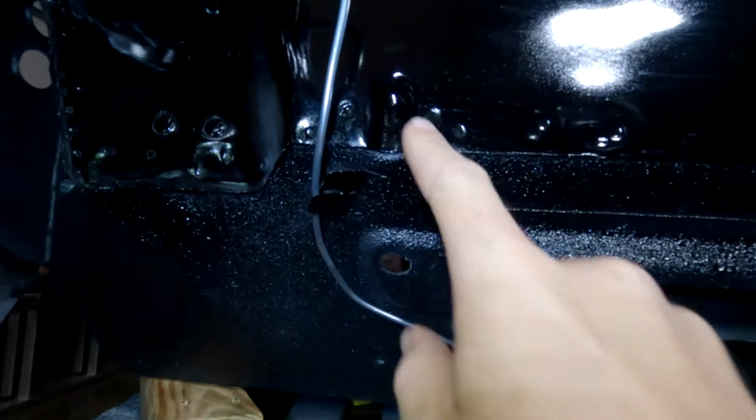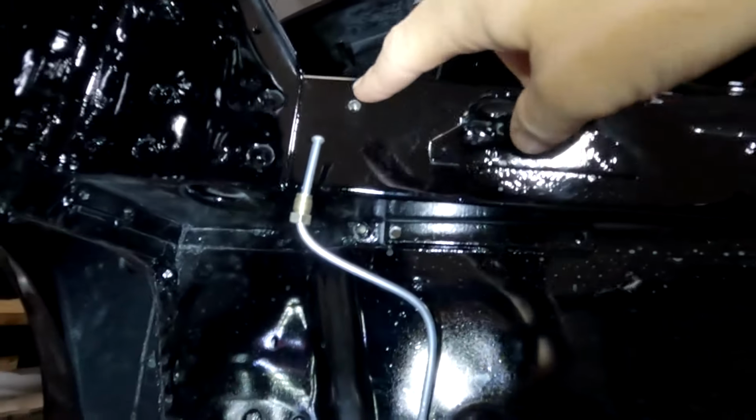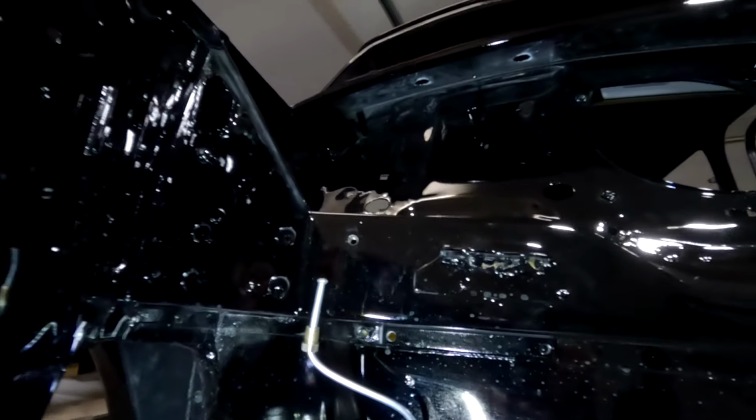It'll then come up, and then you've got what I thought was the T-piece just up that goes in there. I did clean that out with my helicoil kit just to make sure that the thread was okay. It was, which is good, but it's always good to be sure, especially after you've just freshly painted a vehicle. So essentially, what goes up there isn't in fact the T-piece like it is on my Classic Mini, but in fact it is a brake proportioning valve, I believe.